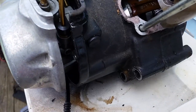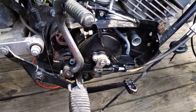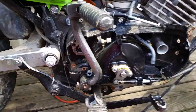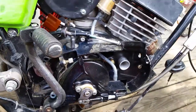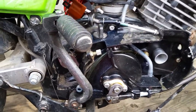Now we're at the bike. I want to show you something very important: see all this dirt? That dirt is going to get into your motor. Before you take apart your bike, give it a bath — pressure wash it, make sure it's nice and clean. No debris, no obstructions, nothing. I can't stress that enough. Dirt is what takes out engines. Engines don't like dirt; they're pretty and they like to stay that way.